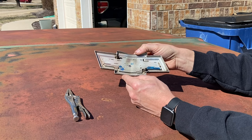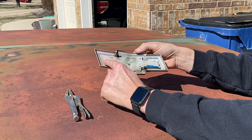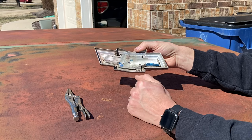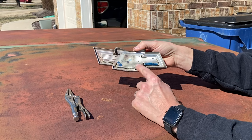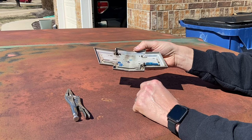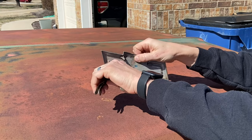This piece of plastic is being held in by six metal tabs. Now, these are pot metal, so they're pretty flimsy — two of them have already broken off. To get these out, you're just going to pry them back with a screwdriver or a pair of pliers. More than likely, they're all going to break, but that's not the end of the world. When we get this all restored up, I'll show you how to retain it back in.